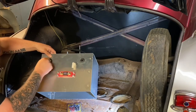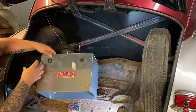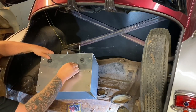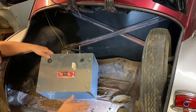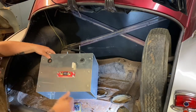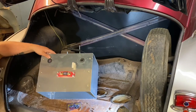The only thing I add are rubber grommets — the battery wire is going to go through here. When the wire passes through anything, make sure it's touching rubber and not touching steel. We don't want it to vibrate, cut open, and burn your car to the ground. I also have a little plastic vent with a rubber hose that goes through the floor. When this battery is overcharging or a worn alternator overcompensates, we'll get sulfuric fumes in here and we don't want those fumes in the car.